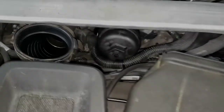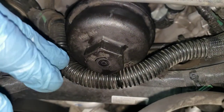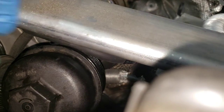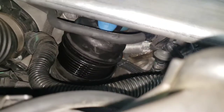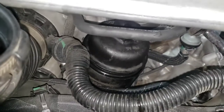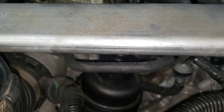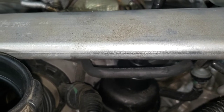I tried one more time to install it from behind the bar — just not happening. Put it in like this — mind the o-ring, you don't want to cut it putting it in. You need to go above this little vacuum line, give it some slack, and rock it forward. You can see I'm getting close to the filter — find those threads and it's going in nice and smooth. Tighten to 25 Newton meters, which is around 20 foot-pounds. Please don't over-torque these things.